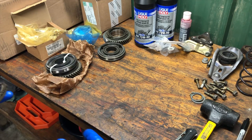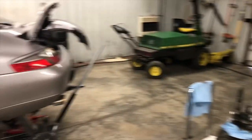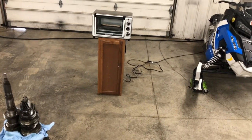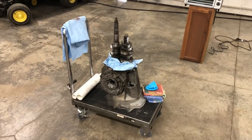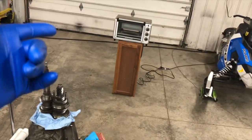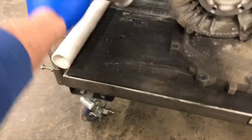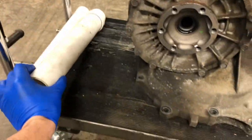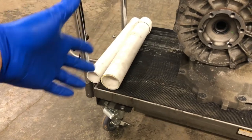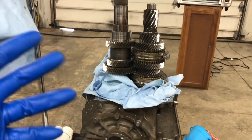I think it's officially time to move to the other side of the shop and begin installing. I've set up shop in the middle of my space with plenty of room to work. This may look goofy — we've got a toaster oven sitting on an old piece of cabinet — but we need to heat these interference fit gears up to 350 degrees to get them to go on smoothly, per what forums say. I have press tools, and I'm hoping that with enough temperature in whatever we're installing, we should be able to press these gears on with relatively low effort. It took a ton of effort to get them off, so maybe I'm being ignorant thinking they'll just press on easy.